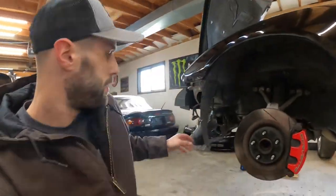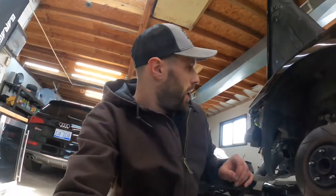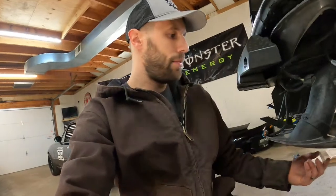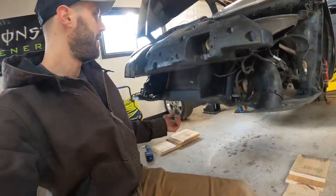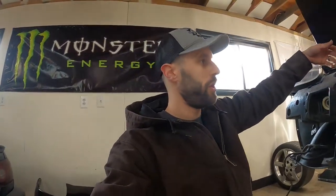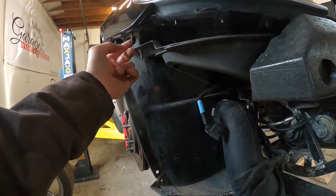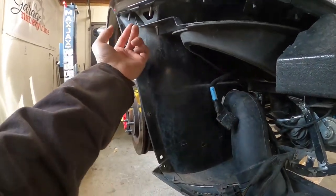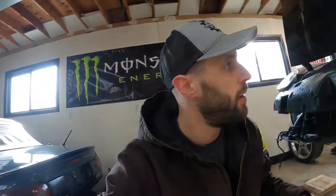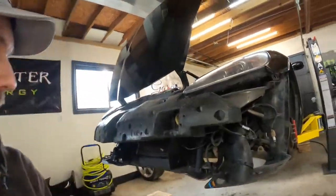When you're taking the bumper off, most bumpers work the same way: you have to take off the fender liner clips, there are usually a couple of nuts on the bottom, a couple of nuts or clips on the inside near the hood, and one or two attaching the bumper to the fender. Once all those nuts and clips are removed it should come right off. Most bumpers also have a little lip on top that lets it sit up there so you can secure it down.